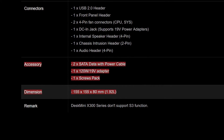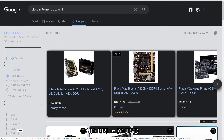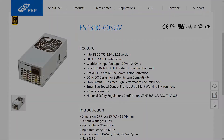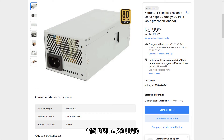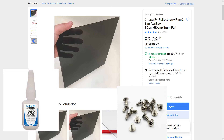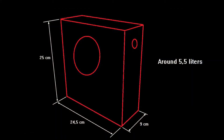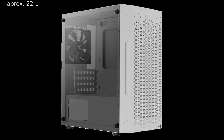For my DIY Mini PC I'm using a Micro ATX motherboard found in Brazilian stores for a little less than 70 dollars. For the power supply I bought a used 300-watt server PSU from MercadoLivre for around 20 dollars. The materials — a 50×50 cm polystyrene sheet costs about 9 dollars, and considering other materials like glue and screws the total is around 14 dollars. The final total is in the range of 105 dollars. With dimensions of 25×25×9 cm this results in a volume of 5.6 liters, compared to a regular Micro ATX case which usually has around 20 to 25 liters.